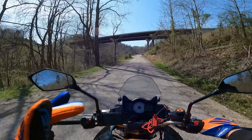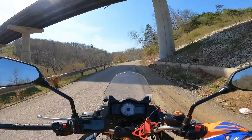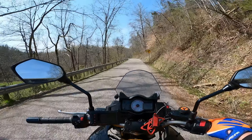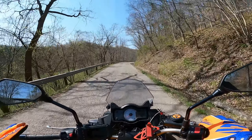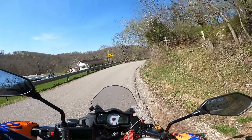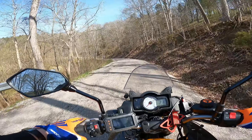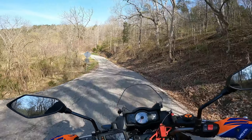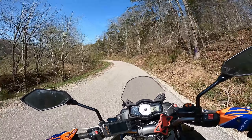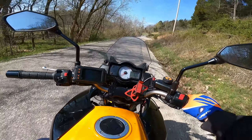You feel like you're gripping real tight but it just doesn't feel good, it's not confidence inspiring. They don't make any 19-inch wheels for this bike anymore, so I put a rear tire on the front, which brings the entire wheel up to almost a 19. From the little riding I've done around the parking lot and driveway it seems to help a lot. This is my first real test ride. If you search 'MX Guru crash Versys' you can actually see me crash this Versys in a gravel parking lot going maybe six or eight miles an hour — the front end just washes out.